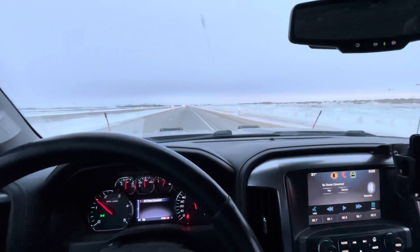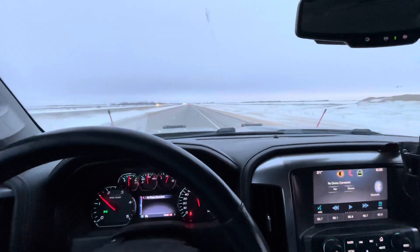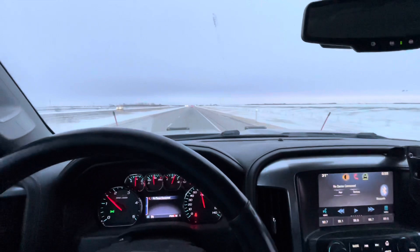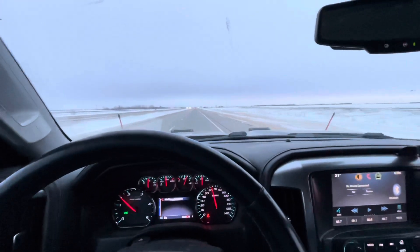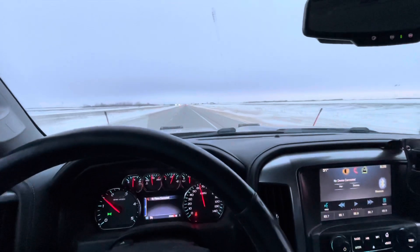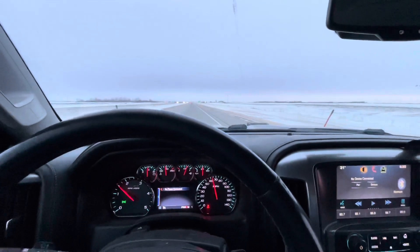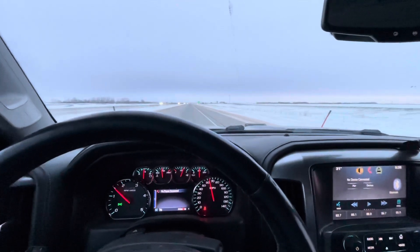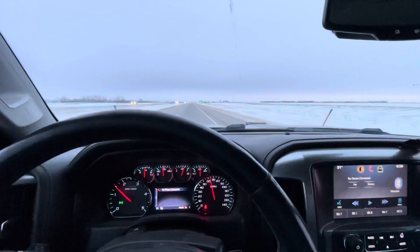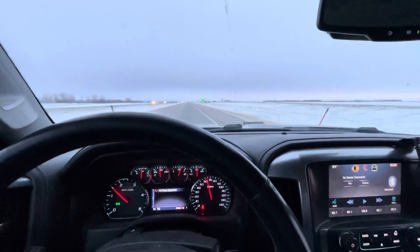All right, we're in the plow truck now, on our way to the airport to check out the 210. We're going to fly her tomorrow from Fargo, North Dakota to St. Cloud, Minnesota. That's the whole deal behind this heater — tomorrow morning when we're supposed to take off it'll be 10 degrees. It'll be 35 in the afternoon. But when we leave, we want to get that motor up to about 40 degrees before we try to start it up, or at least very close to it.